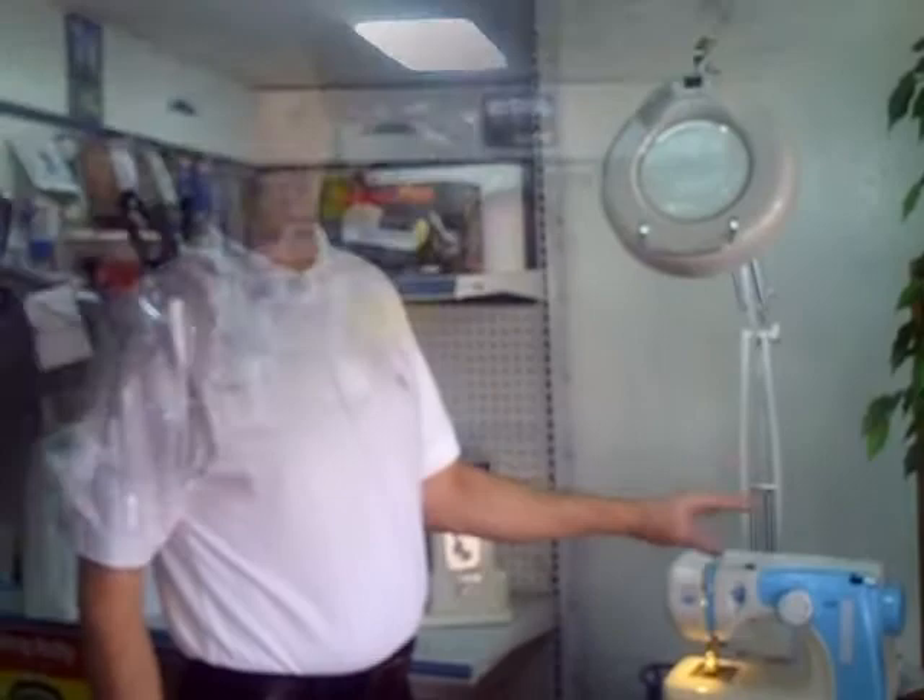I'm going to share a couple tips with you on your vacuum cleaner. First of all, change your belt, change your bag often. If you have a bagless, empty the cup often. Clean the filter often and change it often. They're not lasting forever.